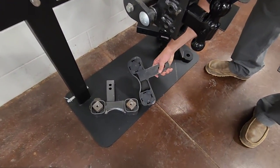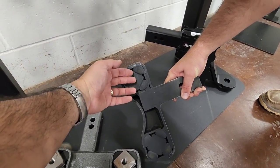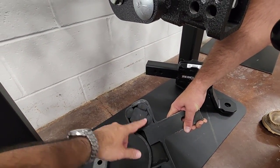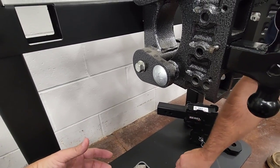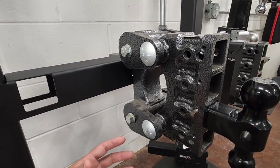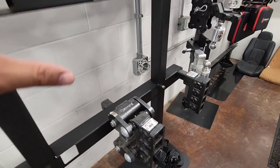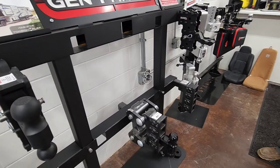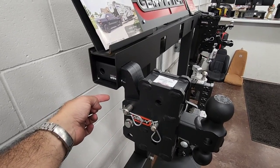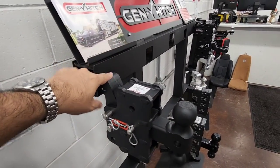Right here you can actually see how the technology works. You've got these rubber cords that surround a solid piece of squared tube that goes through it, and as it rotates it presses up against those rubber cords, creating a torsion suspension effect — very similar to Dexter TorFlex axles or the MORryde independent suspension on an RV. It's those four cords around that solid square tube, and the leverage against them is what creates the suspension effect. Their newer version actually flips around and stows, and it's designed for the GMC and Chevy with the new tailgate-in-a-tailgate Pro Tailgate so it doesn't make contact with it.